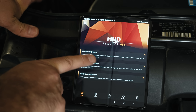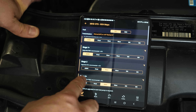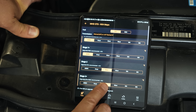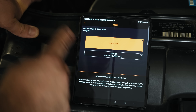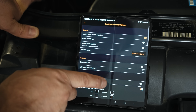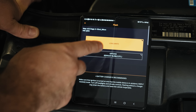We're going to do a long write here because of the number of changes occurring — even if you already have MHD on there, it will be a long write when you make this change. We're flashing an MHD map and can run the Version 9 maps. For your default map, choose either 91 or 93 octane and it will build on that — if ethanol is sensed it will automatically run the ethanol map, provided you have the license pack. Select 93 octane. Don't try to start the car after installing the hardware if you haven't sorted out your license pack first. Go to Options, select 'Motive flex fuel kit installed,' and start the write process.